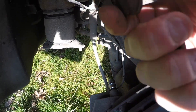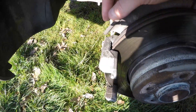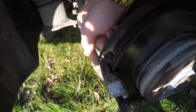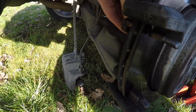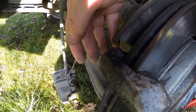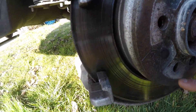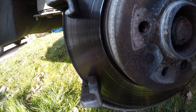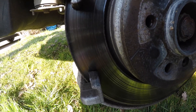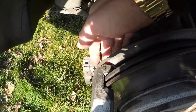You're going to need to take these caps off as well, which are right here on the caliper. The caliper is now off. Next is the caliper carrier — two bolts here, which I think are 17mm on the back. Take them off and the carrier will come off. Then you have to take this allen key bolt out, which is just down here on the brake disc. After that's out, the disc will slide straight out and you'll have access to the brake shoes.